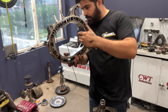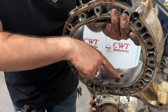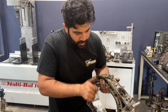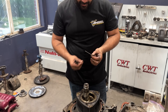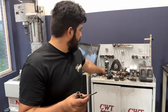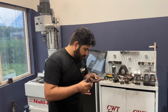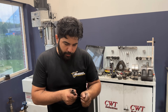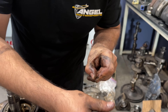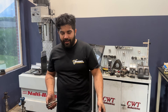Pull it out real quick. Wear-wise, we don't have any corner gouges. We don't have cracking on the spark plug area. Usually high-mileage motors will have cracks right there on the chrome. This is a three-piece apex seal — they stopped doing this in '95, they used a two-piece one. The wear right here, see how it's flattening the spring, and over here it's pointy — even worse. That means it definitely didn't have 5,000 miles. It's still in good condition, but it's not a 5,000-mile motor.